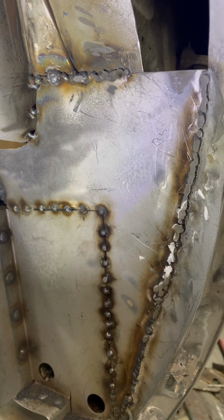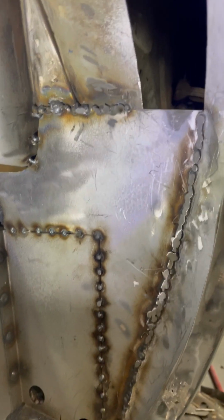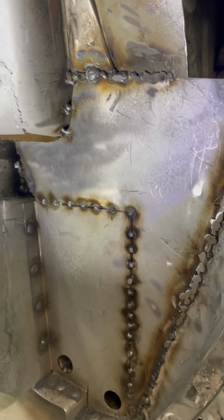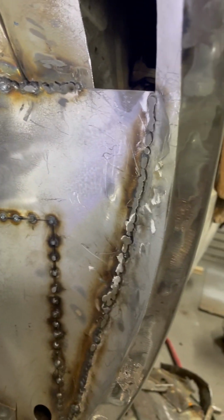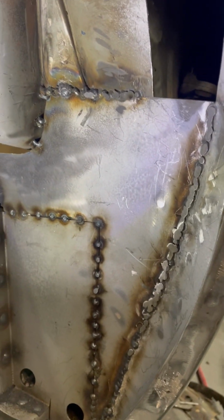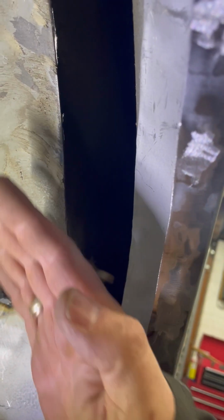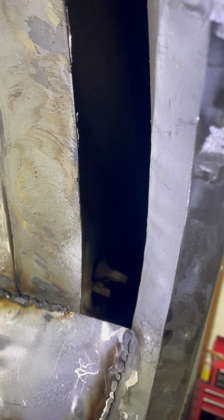I've been using one of those little welding rods because this was quite a gap here, just to take up some of it. Some people call it the coat hanger method. And I'll have to do it in there as well. Obviously the welds look quite hideous at the moment. And then I've just got to go around here. But obviously that curves round with the arch, but it also curves back on itself. So it's testing me big time.